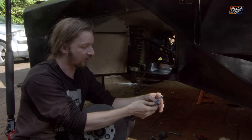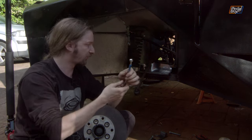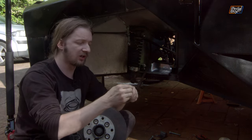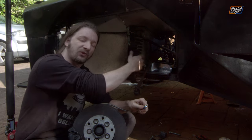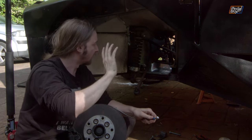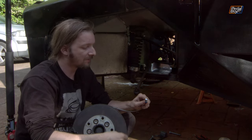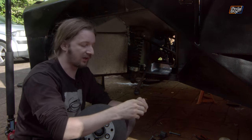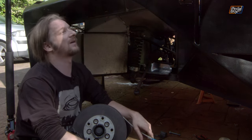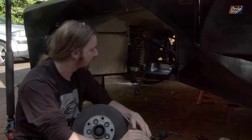By the time we're ordering parts, we thought there was a nicer way to make it all work. It turns out you can get bulkhead through-hole connectors with a banjo on one side and a regular BSP or NPT fitting on the other — the same stuff we've got on the rest of our brake lines. So we thought we'd put an inner wheel arch panel in, which we'll have to do eventually, and use that to mount the adapter. Unfortunately that ended up being an absolute joke — it's taken about two and a half to three hours of effing and jeffing to get it in place.